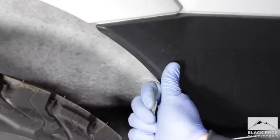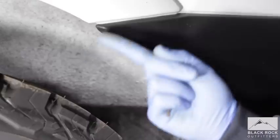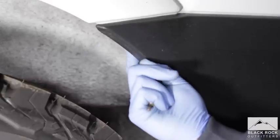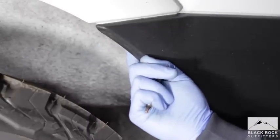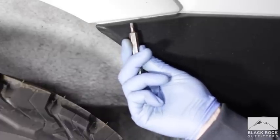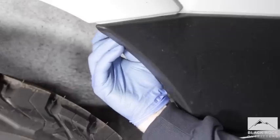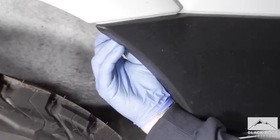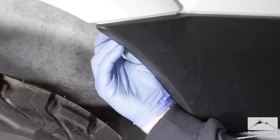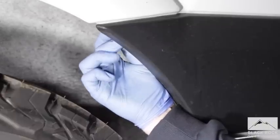Let's take a little look at this side. On these particular pieces of trim, on both sides of the wheel and on the wheel arches, on the doors, you've got a securing pin that secures the plastics to the vehicle. To get those out you're going to need a T20 Torx bit. Just gently slot that into the head of the screw - sometimes they get caked up with mud and dirt off the road, so give it a wiggle to get that dirt out. All you need to do now is get your ratchet, undo the pin, and we can move on to the next step.